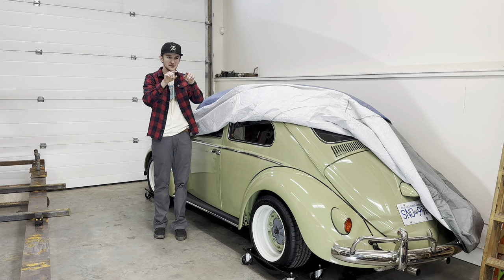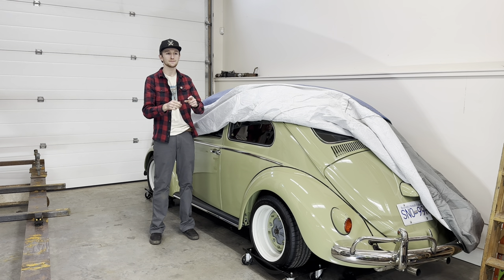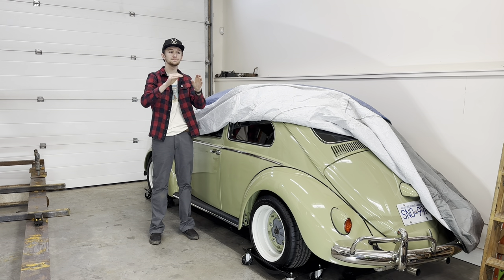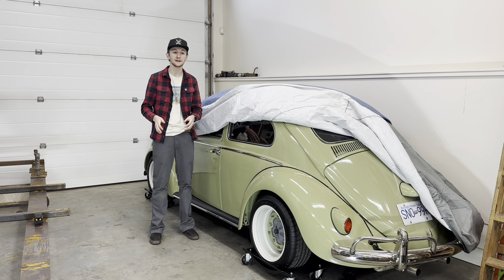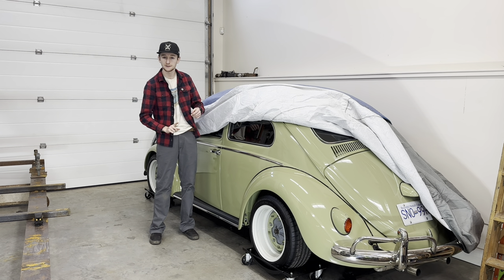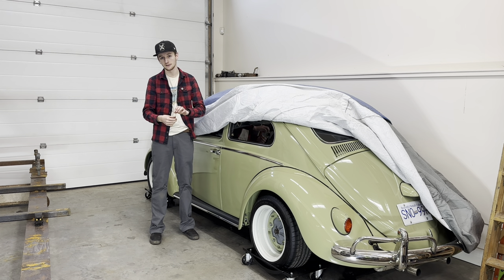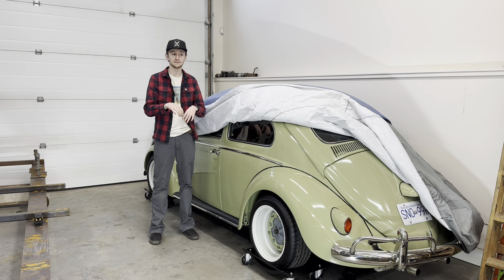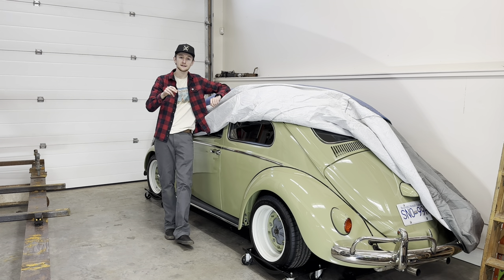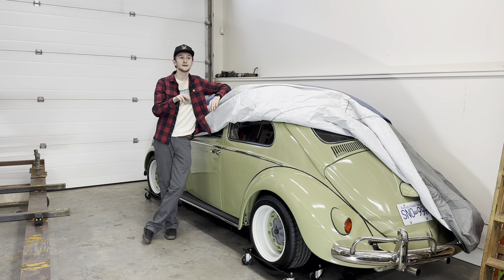There's a U-shaped piece that goes around it with another bolt in the bottom to support it. If you loosen the bolt that goes through the aluminum block and rotate it up, it'll bring your wheels down, which in turn raises the vehicle. Then you use the other bolt at the bottom that screws up to the aluminum block to lock it in place. To lower it, you bring it down. All it does is change where your torsion bars are sitting in the middle — the original front beam already has a bolt holding the torsion bars in the middle, and you're just making that adjustable.